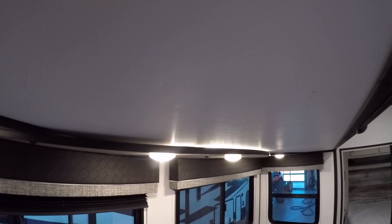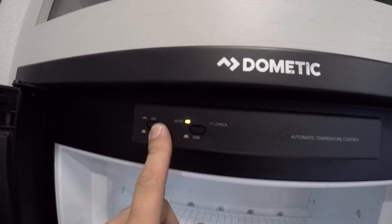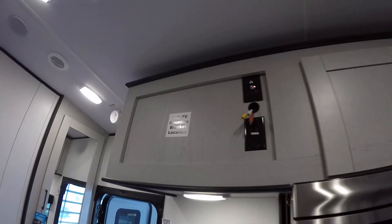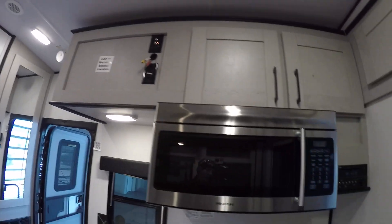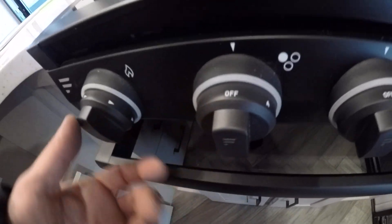In the slide-out, you got individual lights — you'll see these around your unit; they're going to be little tap lights with a button in the center. The LED light is controlled on the very top by the light switch near the fridge. The fridge is going to be propane or shore power — you'll be able to indicate which one when you turn it on. Auto means as soon as it gets disconnected from shore power, it's going to use propane. If it beeps at you, it means you're probably out of propane. If you look at your faucet, you're going to have your keys around your sink. TV hookup is going to be up above. Your microwave is the best indicator if you have shore power — if you are hooked up at at least 30 amps, this microwave will be working. Right now we're just running the 12-volt system. On the stove top, you're just going to use it like an outdoor grill — turn the knob over to the flame and use your igniter.